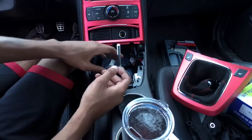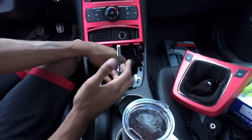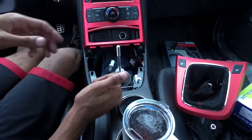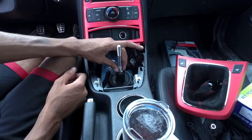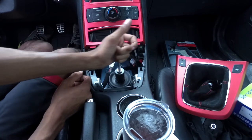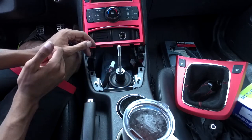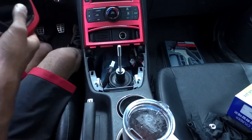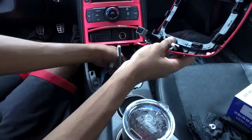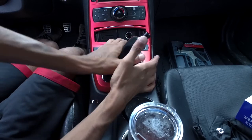It's fully installed. All you have to do after you tighten those two brackets is continue and put the other part on with the washers — it just varies from car to car. I had to use five out of the six washers they sent. Once you do that it's on there, and then all you have to do is slip this back over and put your knob on. You have this locking nut here that will set the height. I used a crescent wrench — this is midway. All the way low brings it down to a really short shift, but I didn't like that. I set it to this height which I think I'm going to like, then plugged the seat warmers back in, brought the console down and locked it.